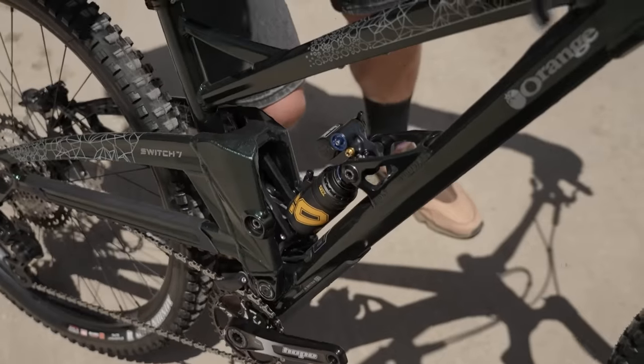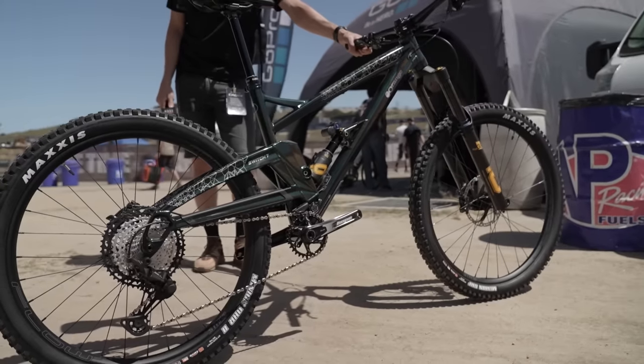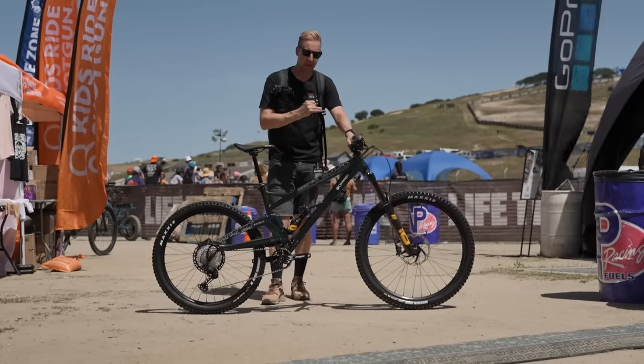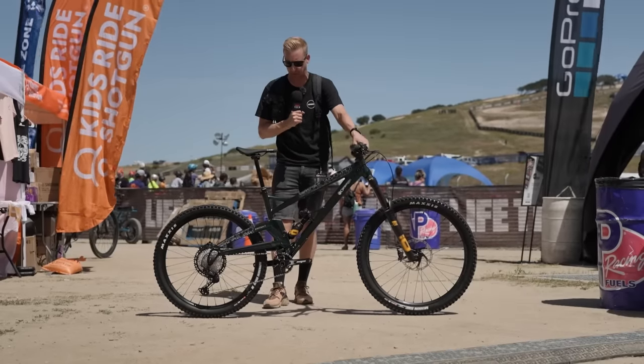Well, hey, slightly refined, totally refined bike, using a linkage they call the Power Link here to add way more support and a more progressive action to really suit what the enduro race is needed. In terms of geometry on here, it's talking 63 degrees up front, 76 on the seat angle there. Reach between 458 millimeters all the way up to 502 on the XL.